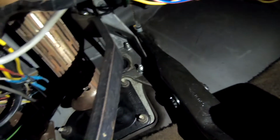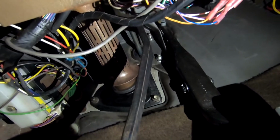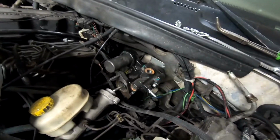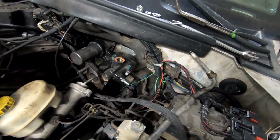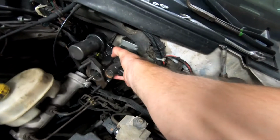Then we got to detach it from the actual brake pedal right there. You might be able to see it in the upper center. And that's our brake right here. So I'm going to knock that out off screen because that stuff sucks and I can't get a camera angle in here. I'll get the new one in. That was actually a lot easier than I remember it being. There were four bolts on that back side. Turns out the very top corner one actually has an access port that I didn't see before. Last time I was trying to get at it with something to get the angle right, and this time I just used a ratchet and went through the little access port, and it worked out just fine. So this guy's free now.